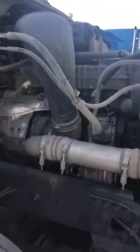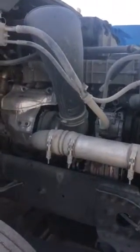I'm going to give a general overview of all my hoses on this side, making sure they're tight and secure at each end. Checking for any cuts, cracks, or bulges, also checking for any leaks, and listening for any air leaks.